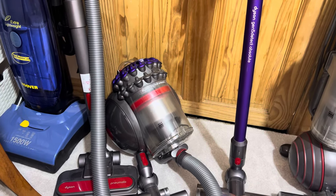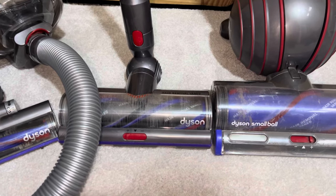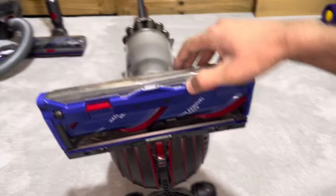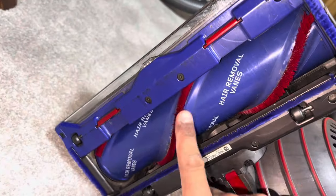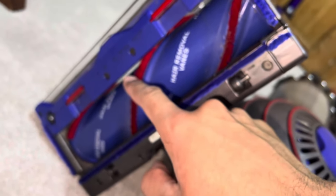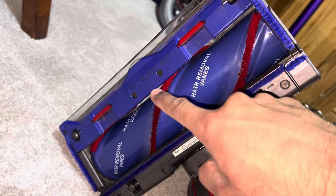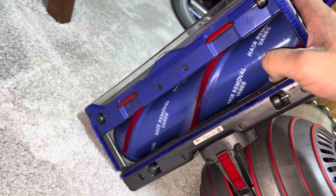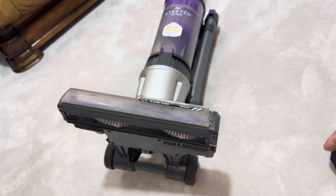So the Dyson Big Ball Animal 2 has been rubbish - it's a straight suction vacuum with only a turbine head at best. The Dyson Gen 5 only has one row of brush bar bristles which are really short. The Dyson Ball Animal UP32 might have an additional row of bristles but they don't stick out the base of the sole plate that much. The DC07 has really high suction but the brush bar bristles don't protrude the base that much, making it ideal only for low and maybe medium pile carpets. Same story with the Vax Air - bristles are way too short and don't protrude the base at all. So how is it going to reach right into the roots of the carpet?